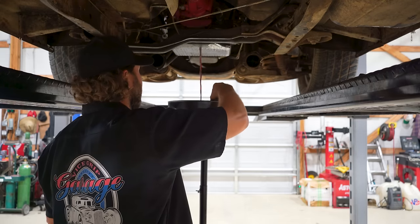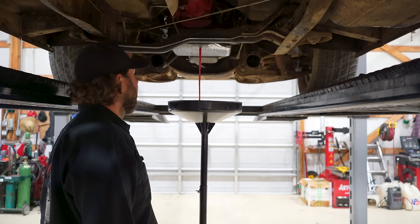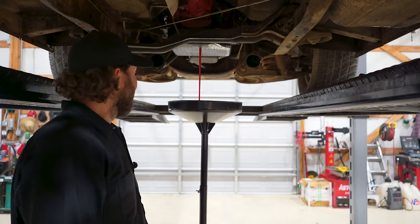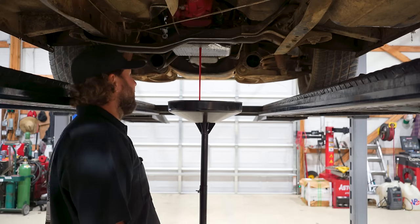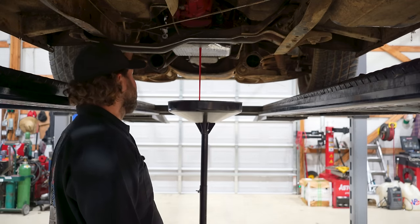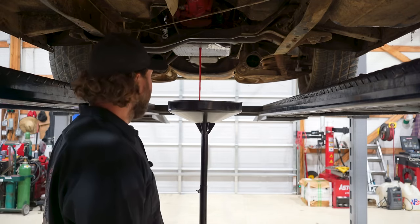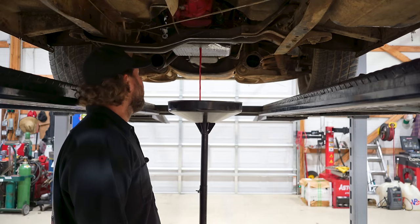That is water. That's milkshake. That's somewhat ATF looking. Wow. I was going to reuse this transmission. Oh boy. So not only was the engine full of water, but so was the transmission. So now I should probably drop this pan and service that as well. I'm going to call up O'Reilly. Have them run me out a fill tray, I think, just to be safe.